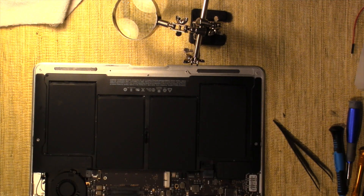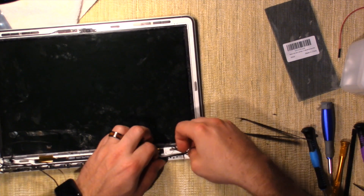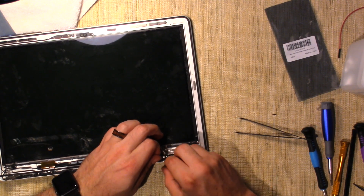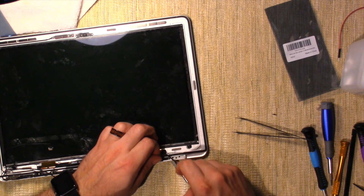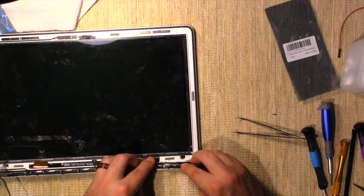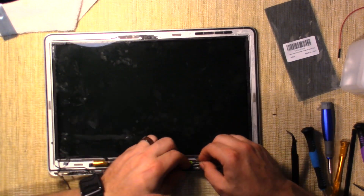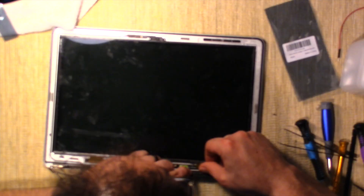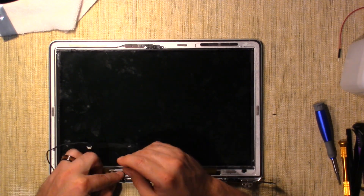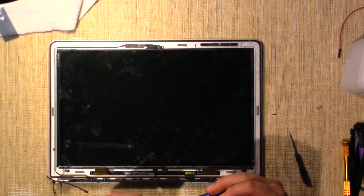The connector on this side is fine — it pushes in and slaps in like so, then you lift this piece out and pull it out. That's the assembly — that's what I had coming in the mail. We've got the new piece. So I'm going to snake this piece very gently right through like so, put it in position, gently seat it, clamp that, and that's going to go there. Put that little metal piece back — I'll just push it back into place with a tiny screwdriver. Put some screws back and get the hinge on with the Torx T9.